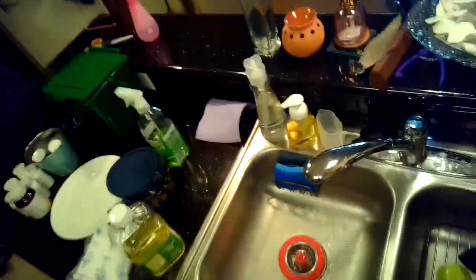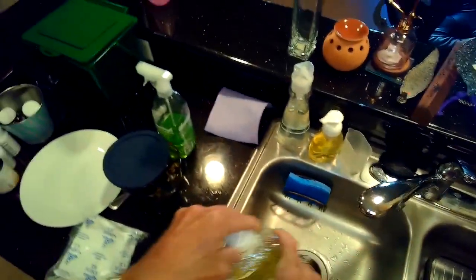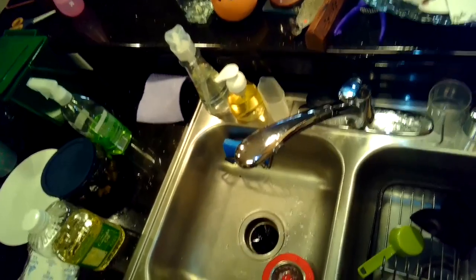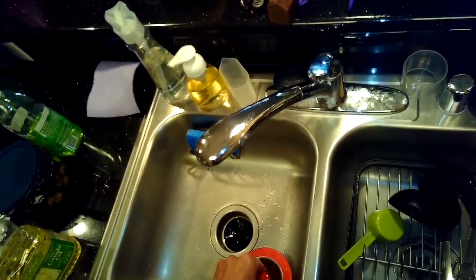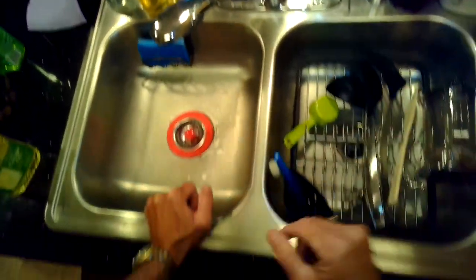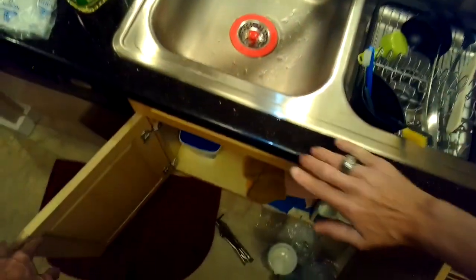There's also the little wrench that comes with your disposer that you can put up in there and turn by hand — that works great. Grabbing it with the vice grips gives you a little bit more leverage if the corrosion is more severe or if food debris has really jammed it. The vice grips give you more torque or power to break up the corrosion.